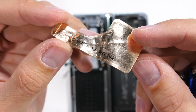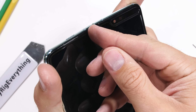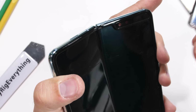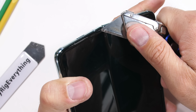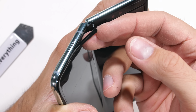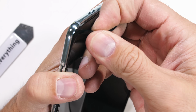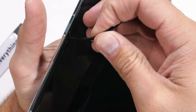We've seen this kind of copper inside of a lot of phones at this point, so let's keep going. It's time to check out the massive internal 7.3-inch AMOLED screen and the complex hinge contraption that holds this whole thing together. Now you probably remember that this is the second time the Galaxy Fold has been released. The first time it launched there was what looked like a screen protector on top, but was actually part of the screen itself. Samsung has since extended that screen protector looking plastic component of the screen up underneath this plastic bezel, so people now won't be tempted to peel it off.